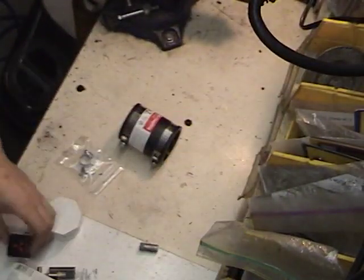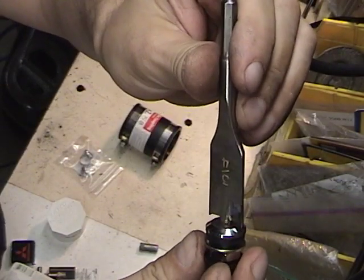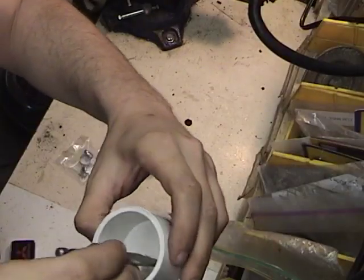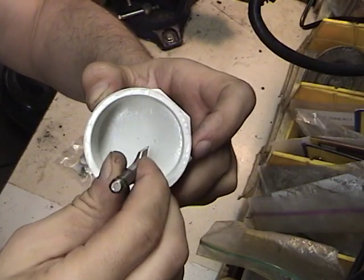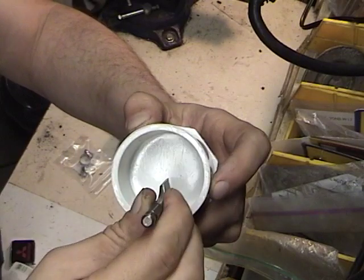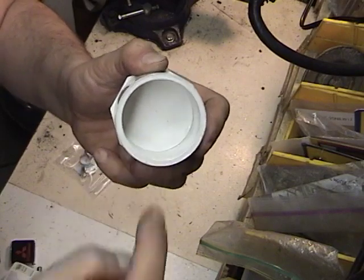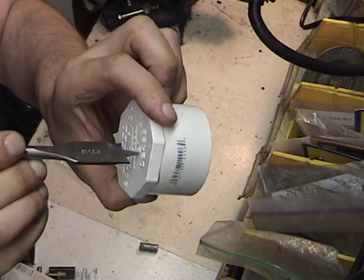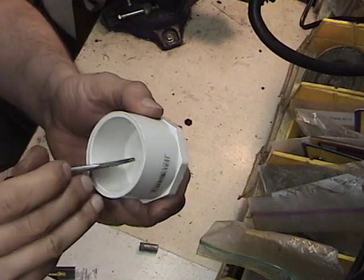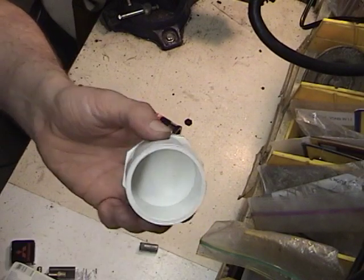Since these pieces are about three-quarters of an inch wide, I like to take a three-quarter-inch paddle bit that happens to be roughly the same dimensions as the top of that piece. It's a good idea to drill from the inside, just to mark the hole, because you want to have enough room to get the nuts and bolts down on top once they're through. The side walls can interfere if you drill from this side and don't have enough clearance to turn the bolt down — it doesn't do you any good. Anyway, I'm going to drill the pilot holes and show you what it takes to make one of these.